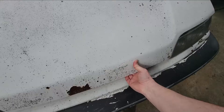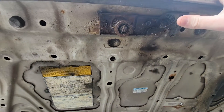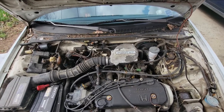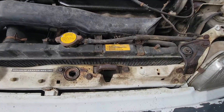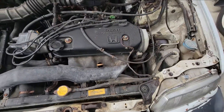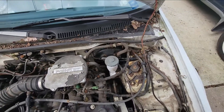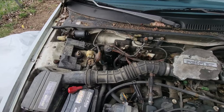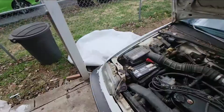Let's look under the hood. Looks like the latch is stuck. We have a D15 B2 — it's dual point fuel injection. It looks like it's missing a bolt on the fuel line bracket. This radiator looks like it's in pretty bad shape; I guess that's why he wanted to keep the one out of the CRX. It's definitely pretty dirty, dusty, and cobweb-ish in this engine bay, but we'll clean it up and put the B16 A3 in here.